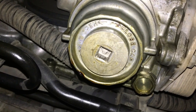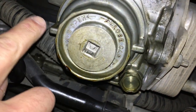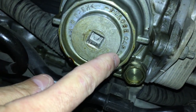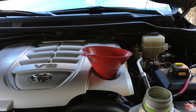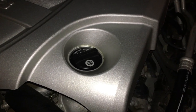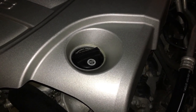Just a reminder: I'm using an aluminum oil element housing and this requires 25 foot pounds to torque it to spec. The cap requires 9.5 foot pounds. After you've removed your old cap, go ahead and put in your oil. After you've put about seven and a half quarts of oil into the engine, reinsert the filler cap, then start up the truck, let it run for about five minutes, and check the dipstick again to see where the oil level is.